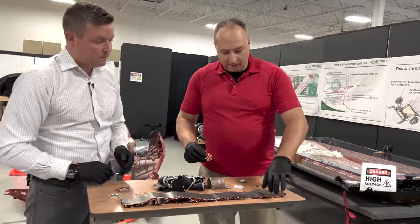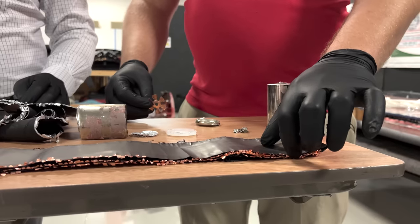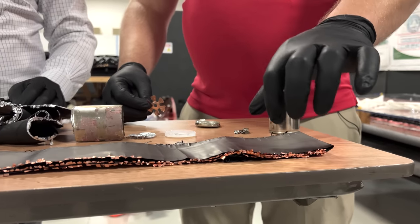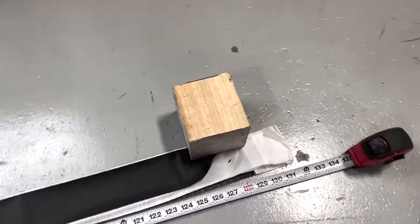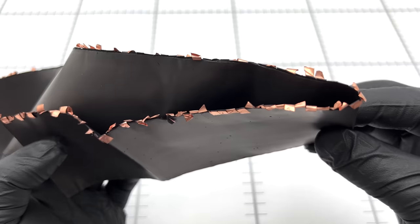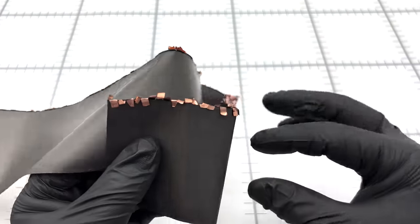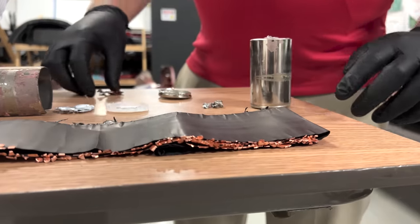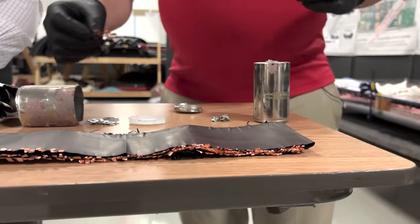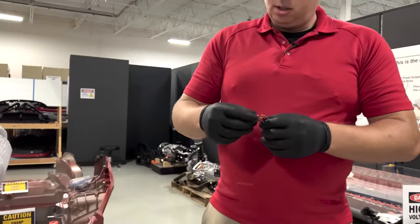In a typical cell, you have one tab with a piece of metal that goes down and is connected somewhere into the middle of the actual jelly roll, and it draws current from that one spot. The problem is when you get to a very long roll like this, you end up getting heat concentration at that point, which can be a failure point in charging and discharge cycles. So Tesla went with an all-tab process — there's no laser weld in the middle; it's a single strip of copper coated on both sides with graphite.